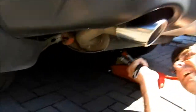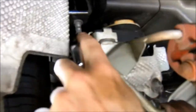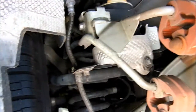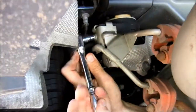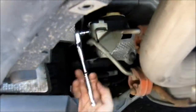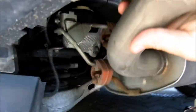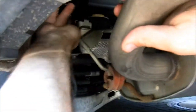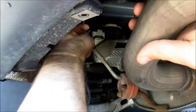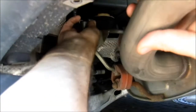What we're going to do now is remove and lower down this exhaust to allow us space to get up here. There's a 10mm nut there which we're going to undo. Just slacking this off - it shouldn't be on any more than hand tight. As you can see, this car under here, we've used this for a year now and it's all quite clean under here. It's survived quite a lot of snow and rain and is as clean under here as when it left the factory. So there's really no need to put this under guard back on if you want to preserve your original bumper line.